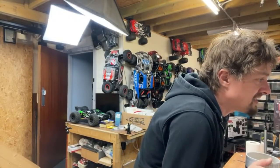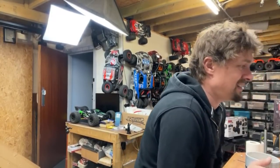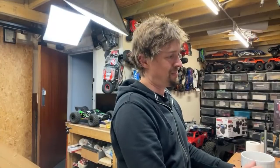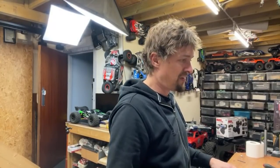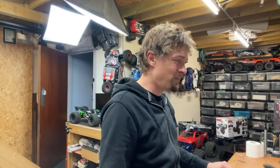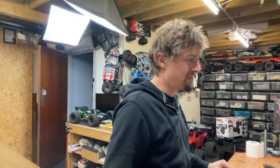Never stock RC says MGM Primal. No, I was tempted, but the MGM speed controllers, they're very high tech, very well made, but there's no case on them. So I think for bashing, you're going to end up ripping them apart. You're going to kill them. So no. If they made one with a basher case around it, I'd be tempted. But the ESC as it is, I think if you get any water on it, it's going to be dead. If you bash on it too hard, it's probably going to be dead. So, I'm probably going to put a flyer in there, I think.